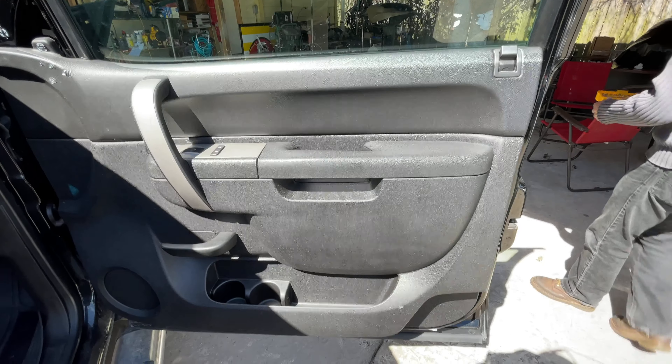First things first, we need to remove the door panel — maybe not, but let's start with this right here. You just kind of get a prying tool and pry out, and then you're going to expose this right here. Take this little foam out and there you have your screws — one at the top and two at the bottom. So we're going to be removing the door panel. First thing is we need to look for any screws available.